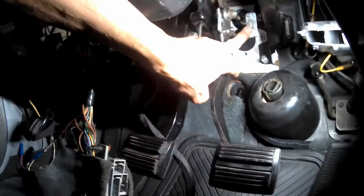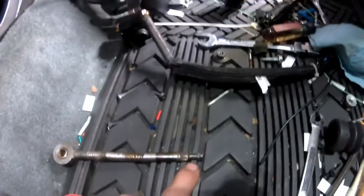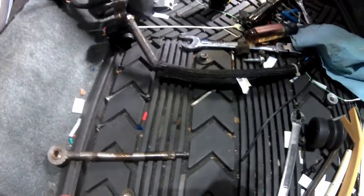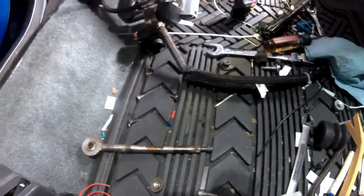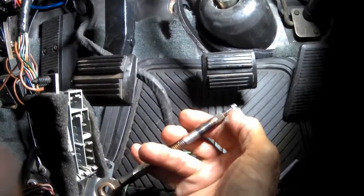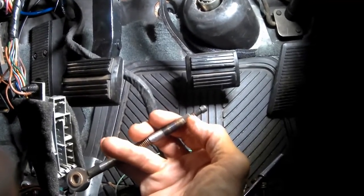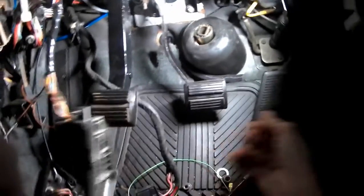This plate I made on my own is not the original. I've got the brake rod out — what I'm going to do is lengthen this. There's a thread on the end and I can extend the very end part out another eighth of an inch easily, and that should give me some more pedal and it'll definitely bring it back so when I let up on the pedal I'm hitting the brake switch to turn it off. I've lengthened the rod, and this turns fairly hard so I'm not concerned about it moving on its own once it's in the car — it took considerable force to move it. You could always Loctite it if you really wanted to be sure. Just because I'm comfortable with it doesn't mean you should be.